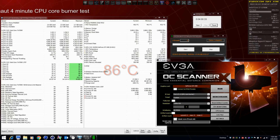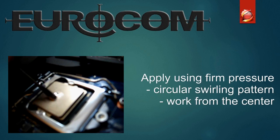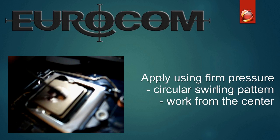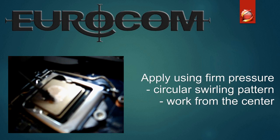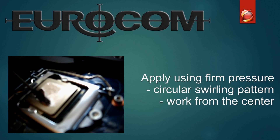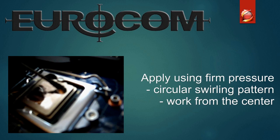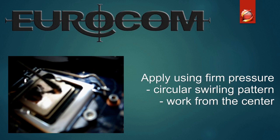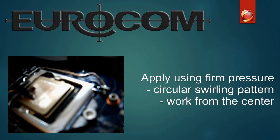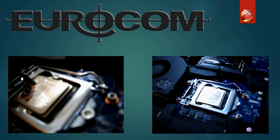As you can see, there are distinct advantages to running a liquid metal thermal paste. A liquid metal needs to be applied differently than a normal thermal paste. You can see here that I'm working with a small dot in the center in a circular motion working towards the edge of the CPU. We'd apply this same technique to the heat sink as well. It's important that both halves come together wet. As we reach the edge of the CPU, you can see that this is producing almost a mirror-like finish — very reflective. We're going to use this exact same technique directly on the copper plate on the CPU heat sink.